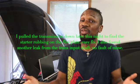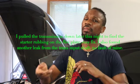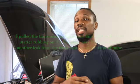Because I'm getting a weird clanking noise that you might have heard in the video. Something is rubbing somewhere, and I gotta hunt that down to figure out what the heck that is, because it's annoying, and I don't know what it's rubbing on. I gotta check everything out. Also, I gotta bring my fuel pressure down a little bit. It's a little bit high. Gotta adjust the Radium fuel pressure regulator, just bring that down a couple PSI, but yeah, it's good. So I'm gonna sort out just those two issues.